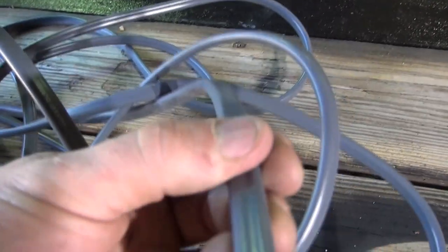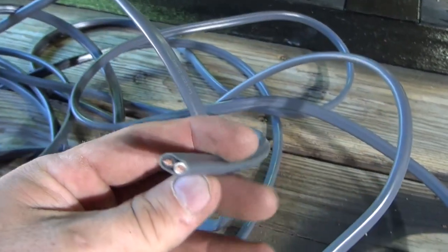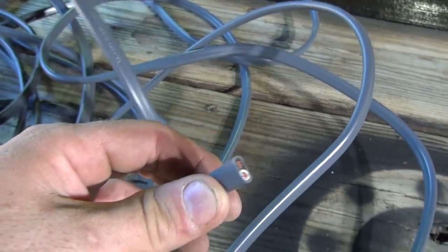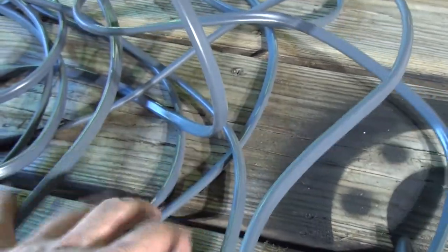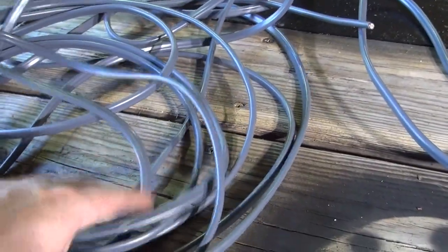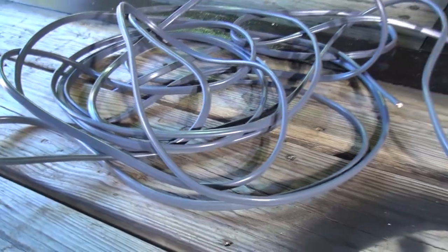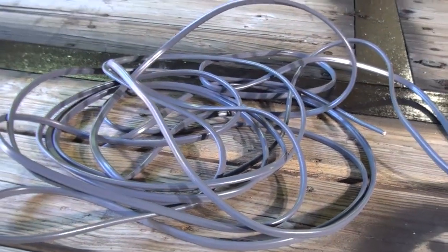What we're going to do is upgrade this to 10 gauge wire. The only place I found to buy this by the foot is at eTrailer.com — you type in how many feet you need, measure and add a few extra feet. I measured all the way back to the rear of the trailer and added extra for the neck. I wound up ordering 36 feet — I think I need about 33, but I wanted a little extra because you can always cut it off but you can't make it longer.